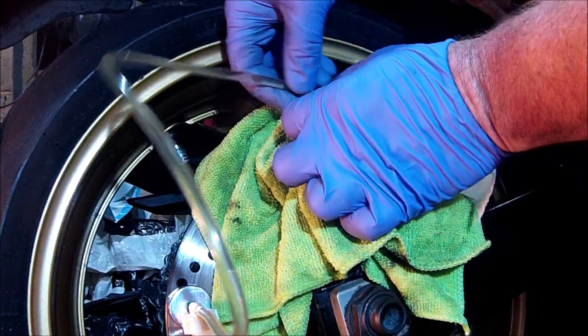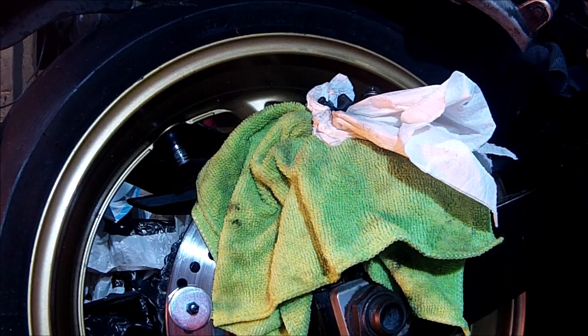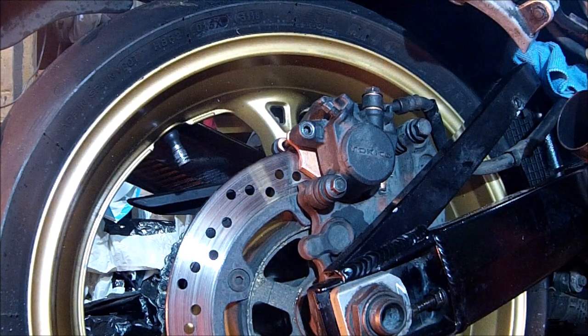Of course it's totally different pushing it down with your hand than actually sat on it. That's pretty much straight-on braking. The reservoir is okay. Oh yeah - now that is a solid pedal. So that is going to be good enough. Being it's on the back, I don't mind giving it a test run. And if it's terrible, I'll go back up and readjust. But there's been no bubbles for a little while there. One fully bled, new brake pads, new seals - restored, rebuilt.